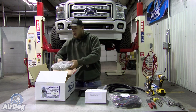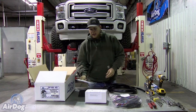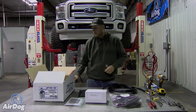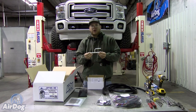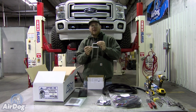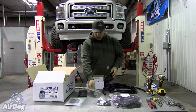We're going to go ahead and get this fitting box opened up, take a look, and then pull this factory lift pump off this truck and get this install going. On this truck we will utilize a fuel return Y — this will tie your two factory return lines together and add the AirDog return, so there's no need to cut the filler neck and do an inline style return there.